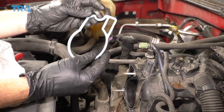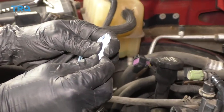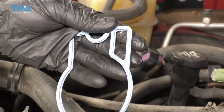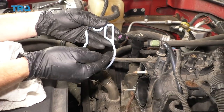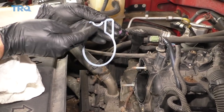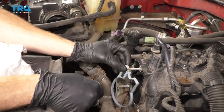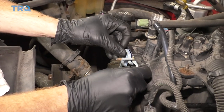This one, in all honesty, actually looks pretty fair. If I give it a nice squeeze, it doesn't feel dry and brittle in any way. If it's cracked or even if it's dry and brittle, you need to replace this gasket. Otherwise, it's highly recommended you replace it. In this case, I'm just gonna go with the assumption that you have a new one.